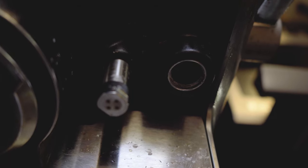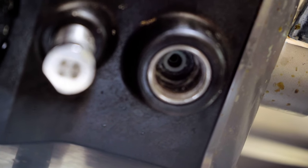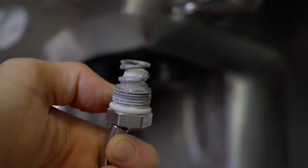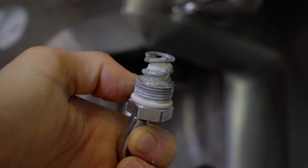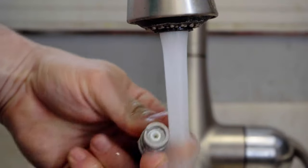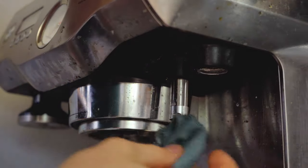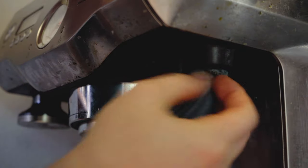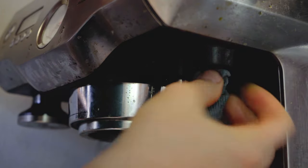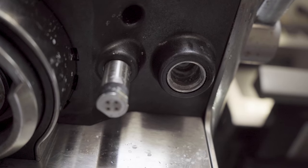There is a blue o-ring in this assembly — it may come out or it may stay seated inside, so be sure not to lose it. There's some obvious scaling along with other buildup here, so we'll scrub this clean. We also need to clean out the inside. There was significant scale buildup in mine, and that scale can easily come loose and continuously clog the steam wand tip.